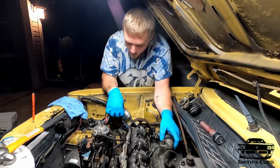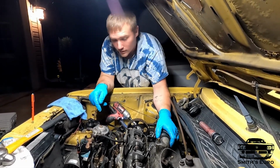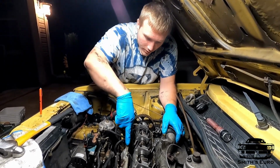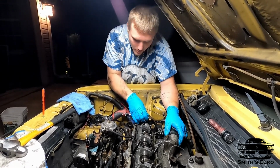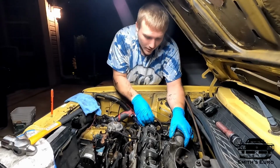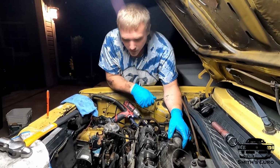But the common thing is, at least I had to do it before, when I had a 1.6 diesel, because this doesn't look like a turbo diesel block to me. Usually a turbo diesel block has 2 big oil returns up front. I've been through all that, and this guy told me it was a turbo diesel block. Bought it at night. Messed myself up. But I don't think it's a turbo diesel block. I think it's just a 1.6 diesel. So we'll see. I'll try to find some sort of identifying markings.